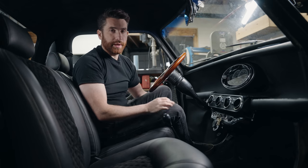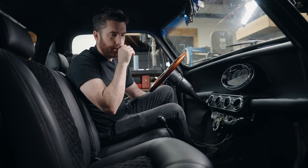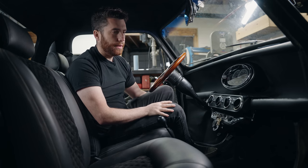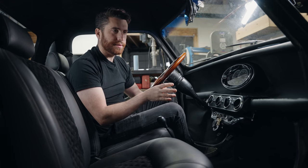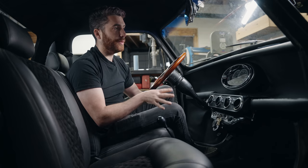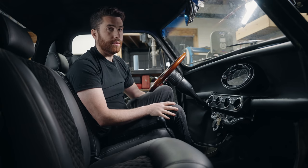At this point, we're pretty much ready for the engine. We've got a couple of photos showing how the engine's coming along. It's a D16Y8 engine, fully rebuilt — just going through that process right now. The transmission is back and that's going to be fully rebuilt as well. We're using a D15B2 transmission, which has the longer gear ratios — so you'll get the most powerful engine with the longest gears, which will work best with the 10-inch wheels. Once that's together, it'll just be a matter of installing it. We've got a couple of other cool things with the cooling system that we'll go over in the next video.